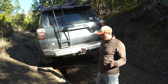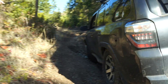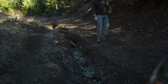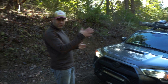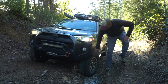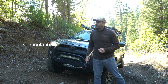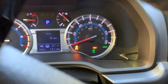We may not even complete it with A-TRAC, but we'll give it a shot. You can just see how that wheel is stuffed. With independent front suspension vehicles, they don't have a lot of wheel travel — especially when you lift them, you limit the down travel they have. Over here, you can tell that one tire's been spinning; you can see where it's rubbed away there, and the other one has been doing nothing. So we're going to use A-TRAC now and see if we can get ourselves out. A-TRAC button right there. You can see on the dash it's illuminated. We're ready to rip.